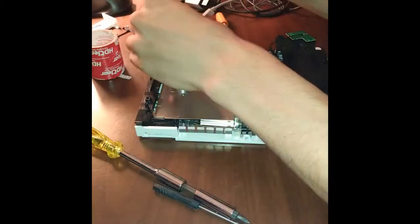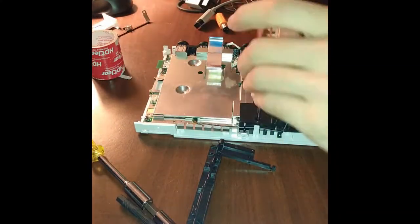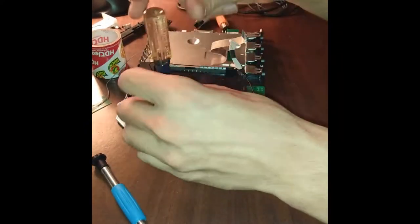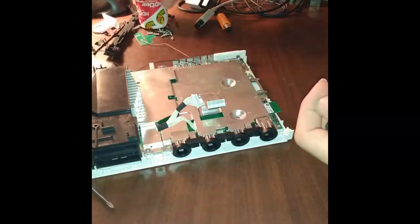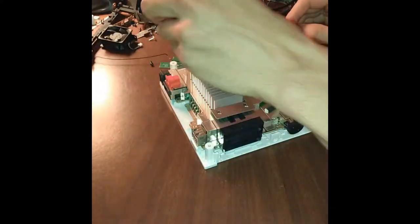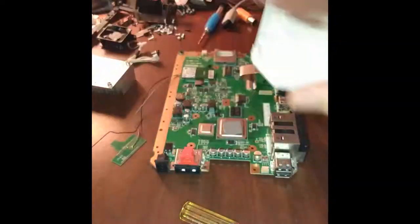Mismatching screws can lead to a lot of different troubles. Everything from stripping sockets, damaging the case, not using the right screw and then having it come loose after assembly, and shorting something out, and in a worst case scenario, probably wrecked motherboard traces. All these things are a reality if you don't match up the screws right. So, with that, let's go over how to reassemble a Nintendo Wii properly.